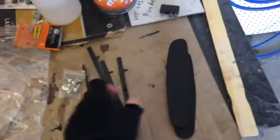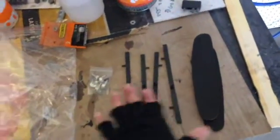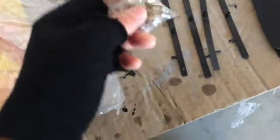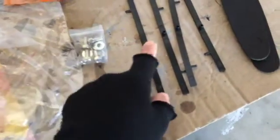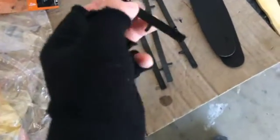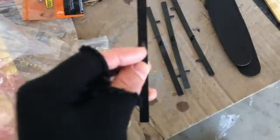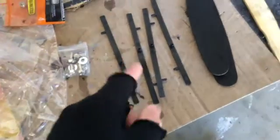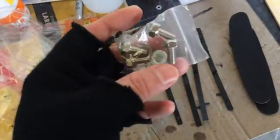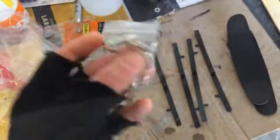So you may have your own preferences on how you want the spoiler to be. I got this on eBay, and you know what? They gave me all these things. They didn't give me instructions on how to do it, but that's okay. So you got the bolts, and then you have the guides on how to drill. You see the little hole there? So you'll start off with a small drill bit, and then work yourself up to the size of the bolt. I don't know what size of bolt this is, but you know what I mean? It's not that big. Alright, here are the drill guides.